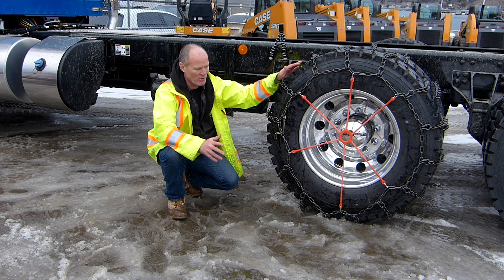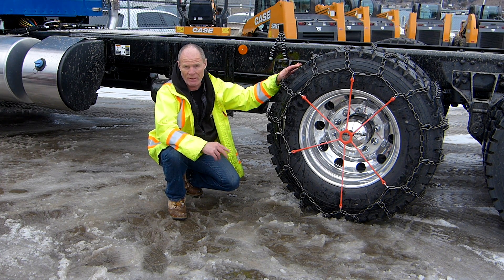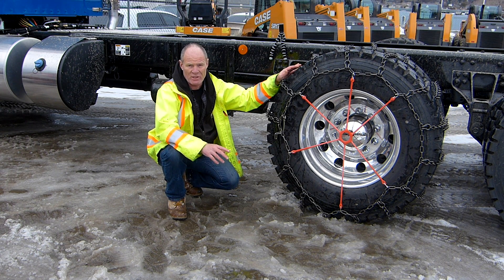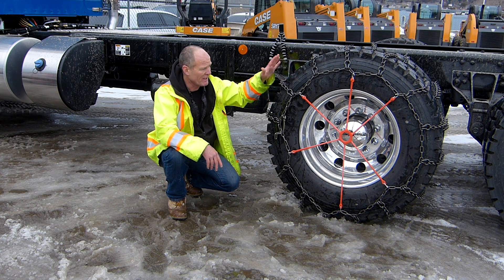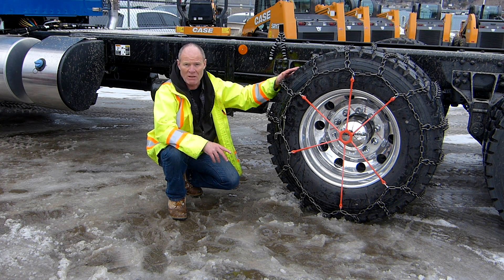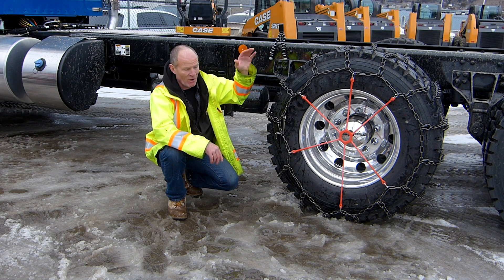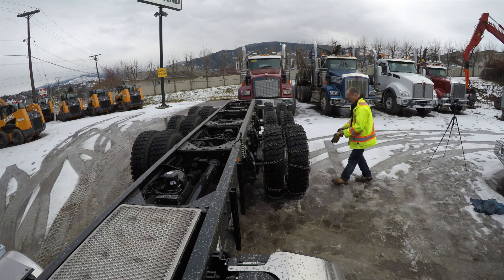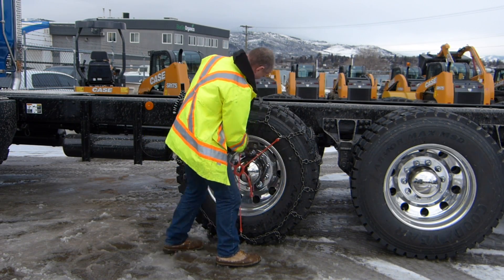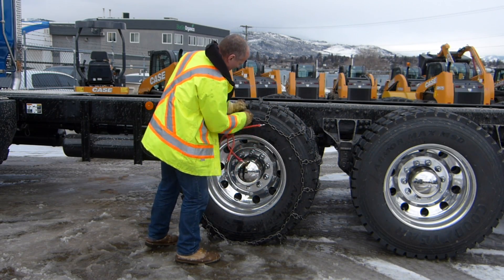You can see we've got it all chained up and you're ready to go. You always need to put chains on the front axle, especially if you're driving a tandem axle — this is a triple axle. Most trucks have a power divider which locks across the front axle, and that's where you put your chains so you can lock up the differential; otherwise it's not going to do you any good on snow and ice. Most logging trucks like this one have power dividers that lock all three intra-axles so the whole thing churns. As one old timer told me: going up the hill, you don't have steering power because the truck is just pushing you forward, so they'll turn them off going around a corner, then turn them back on to get up the hill.